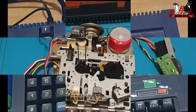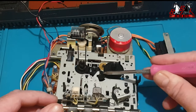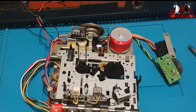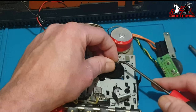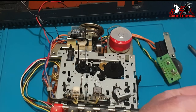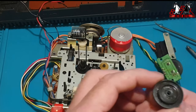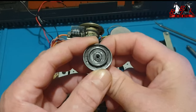I'm just going to pull this to pieces and we'll take a look. So we've got the Amstrad stripped down - this is the tape deck and this is the pulley that I'm looking at changing. This other drive pulley here - I believe there's a clutch underneath there, so I'm going to pull that little fiber washer off and slide that up and take a look. Be very careful not to lose these washers because if they come off they're gone - they're so tiny. So there's that little clip - set that to one side and that should just slide up and off.